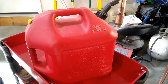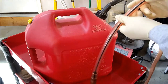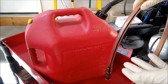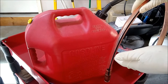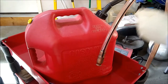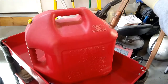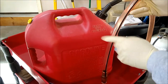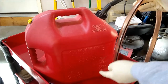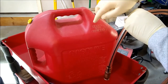To give you another view of how this works, you put the tube into the can and then pull it up, creating that pump action. One of the drawbacks — and why my video from a year ago failed — is I forgot to hit record on the camera. The golden rule with one of these is once you get it started, don't stop. The height of gas in the can is basically equivalent to the stroke of a piston engine — the more stroke you have to fill the tube with fuel, the better it's going to pump. When you get it down really low in the can, it's very hard to restart the siphon. Once you get one of these going, don't stop it until you're ready to stop pumping fuel.